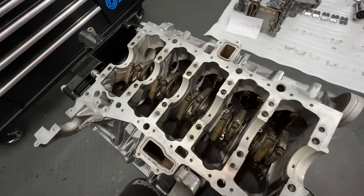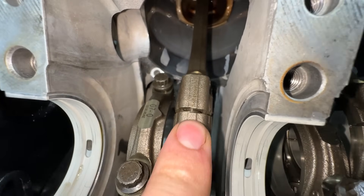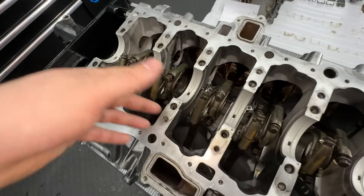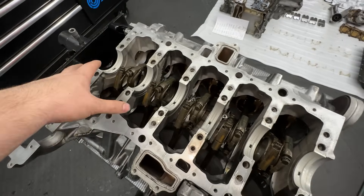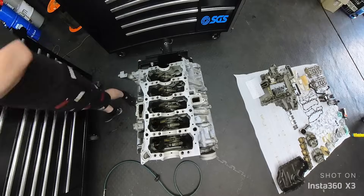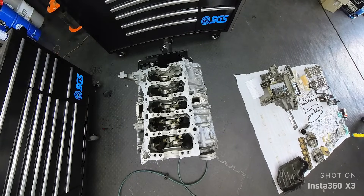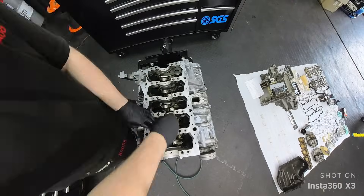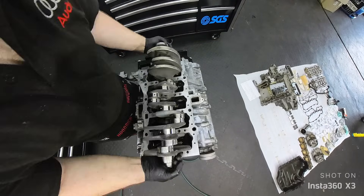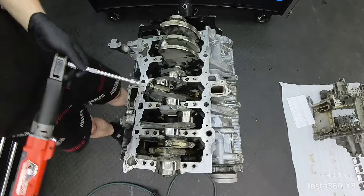Progress - all the pistons with rods are inside. I'm just going to mark now which one is which. These are the ones which are actually broken off, so they will only fit to the other piece - you can't mix them up. We have to clean up the surface for the conrods where the bearing will sit, so they are nice and clean with no oil or grease. Then we're going to put the crankshaft in with assembly lube on the bearings and measure the clearance between the rods and the crankshaft.